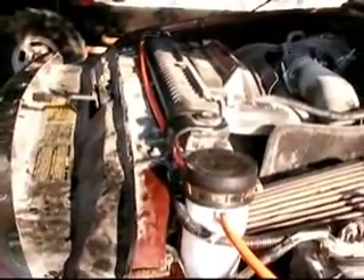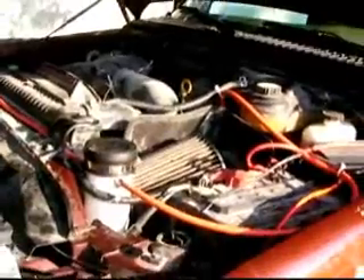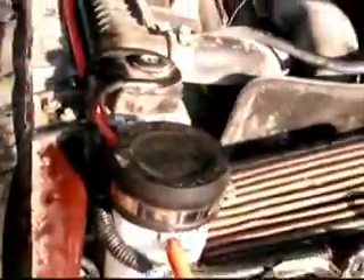The amperage hasn't stabilized — it jumps between 38 and 44 amps — but I haven't had any kind of a steam problem. It goes right here before the turbo, on the inlet — the vacuum side of the turbo is where you want to put it. It's behind what I'm pretty sure is a MAF sensor. I'm 100% positive that is an MAF, even though I was told erroneously that diesels don't have an MAF — well, there's one right there. The output looks good. I'm going to turn this thing on and show you inside the bubbler.